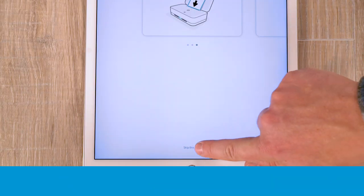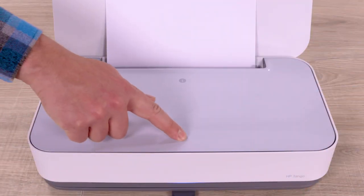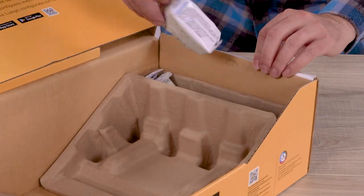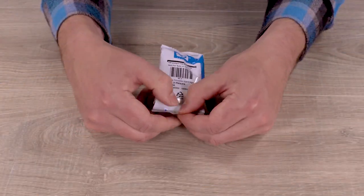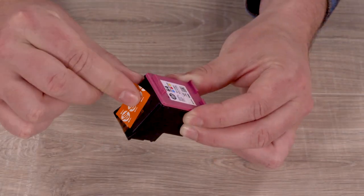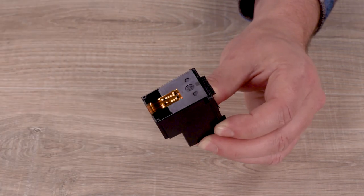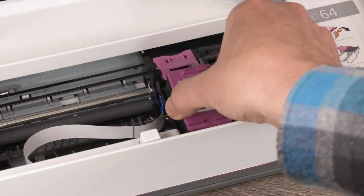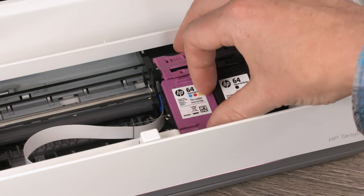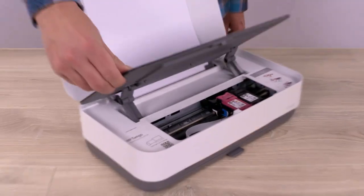Return to the app, and then tap Next, or skip this step. On the printer, press the button to release the ink door, and then lift the door until it locks in position. From the printer box, remove the two ink cartridges and take them out of their packaging. On each cartridge, pull the orange tab to remove the protective tape, making sure to avoid touching the contacts and ink nozzles. Insert the cartridges into the printer with tricolor in the left slot and black in the right. Squeeze the tricolor cartridge and latch together until it clicks in place. Repeat this process for the black cartridge, and then close the ink door.